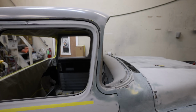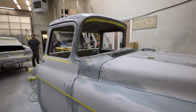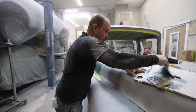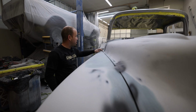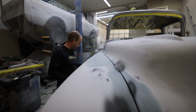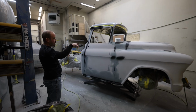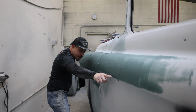What I've been doing is putting Duraglass, which is a fiberglass body filler, on and just blocking away my little heart. And yeah, just making sure all these panels are exactly matching. If you look down here, I've also gapped them, so they're all 5/16 going all the way down. And then we hit it with the DP, because I went and hit metal on a few spots. I'm doing the other side right now, and then the front of the fenders.